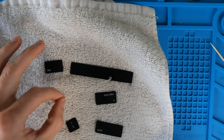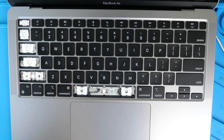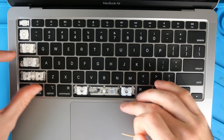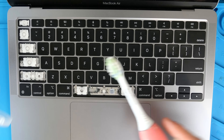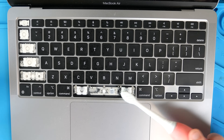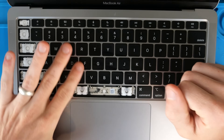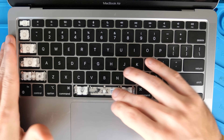To clean the actual keyboard once the key caps are removed, blow on your keyboard or use some compressed air to get in there. If your key switches are junked up with a sugary drink, take a toothbrush with some isopropyl alcohol and work it into the keyboard and into those key switches — move it around and work it on every single key. A high-percentage isopropyl alcohol should not harm your keyboard and should help clean out any junk and gunk.